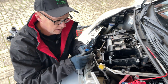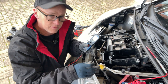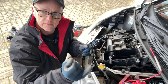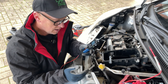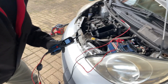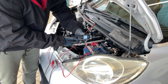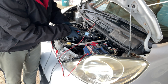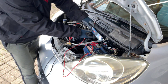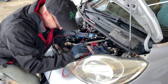In two seconds we've literally just checked the fan. We know the fan unit is okay. If you've got overheating problems and the fan's not working, with this tool it's click, click - done. We've checked the fan and know it's okay. If there's an issue it's with something else. We know we've got ground, so it's going to be on the positive side - could be the fan relay or the fuse. Speaking of fuses, in the fuse box here we've got a number of fuses we can easily check. Just go to DC volts and touch it on those fuses.